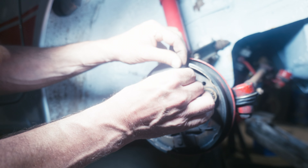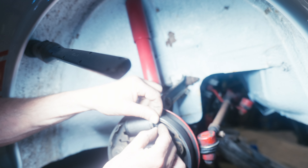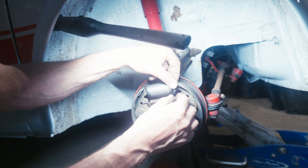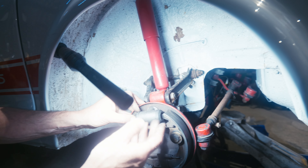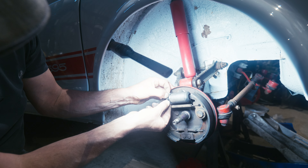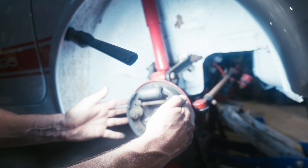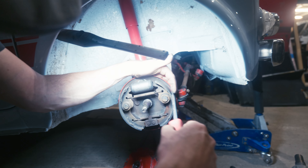Let's have a look underneath the dust seals and see if we've got any brake fluid coming out. They're clean — well, there's a tiny little dribble of brake fluid there. Probably not enough to worry about, but if you took that out and it all splurged out, the seals inside have gone. Because they look new, we might find new ones are worse. This one doesn't look too bad either. So the next thing is to see if the pistons are free — if they're seized up. You can do that by moving the shoes across, putting levers in either way.